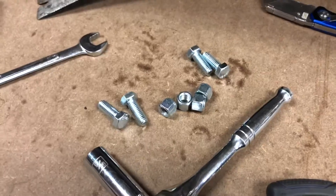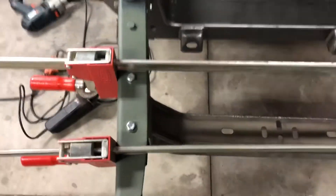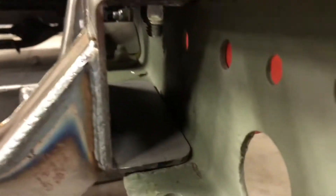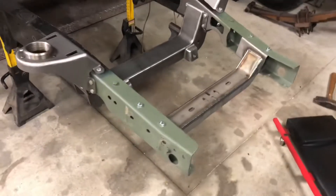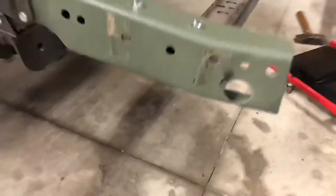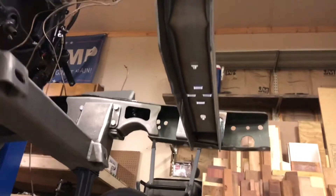The kit came with four extra bolts, so I'm guessing that since there are only four bolts for the top with holes already drilled, there is nothing pre-drilled on the bottom — either on the frame or inside. So no fun there — my favorite thing is the drill. Not too bad for a day's work. We got all the holes drilled, got them all torqued down at 35 foot-pounds. Got the underside two holes drilled as well. Radiator support is in.